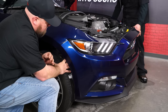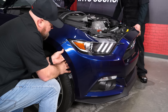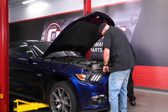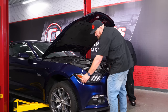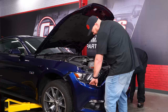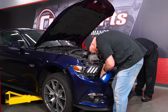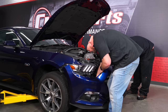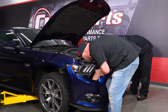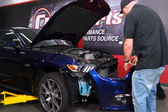Okay, so we're ready to remove the bumper. An extra set of hands will definitely come in handy here, but this part tends to break on these cars. You want to get your hand behind it and sort of shimmy it out and it'll pop off. Once the side's off, you can lift up the center section and get it off the studs. The wiring harness will be on the driver's side — start there, then unplug it, and move it from the car.